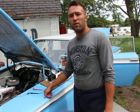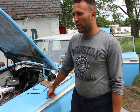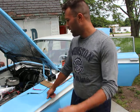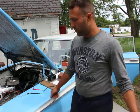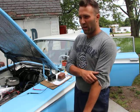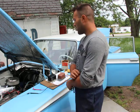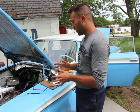Now, if you put 30 volts through a 6 volt system, it will fry it. Everything will be damaged, all the electrical. The spark plugs maybe not, but the battery will be damaged, the starter will be damaged, the generator, alternator will be damaged, all the lights will probably be burnt out, the gauges will probably be burnt out, you'll fry your radio. Everything that got too much voltage or current will be fried. So how do you control that voltage?